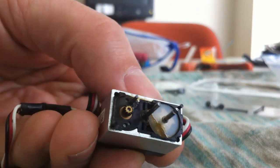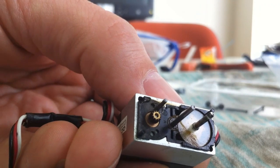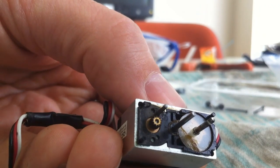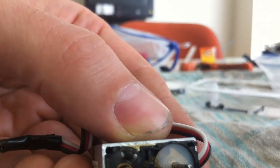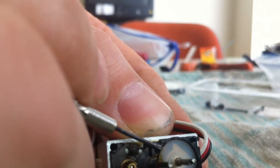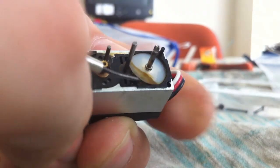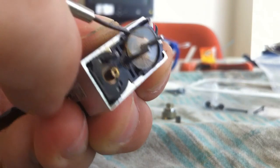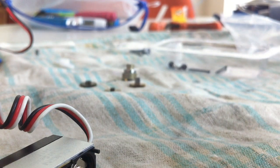What we're going to do is remove this little plastic cover. You can actually see the grease that's come down off the gears and gone onto that little plastic cover. My bet is some of it has gone down onto the tracks of the pot. So we flick off this little cover here, and you can see it's quite dirty on both sides. We give that little cover a good clean.